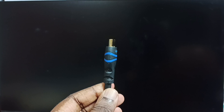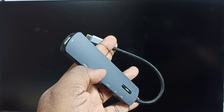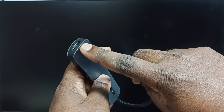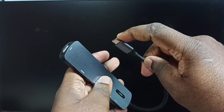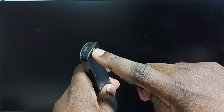This is the HDMI cable from TV. I have connected this HDMI cable to HDMI port 2 of the TV. We need an adapter like this — this is USB type C to HDMI 2.1 adapter. This USB type C pin we can connect to iPhone, and in this HDMI port we can connect the HDMI cable from TV.